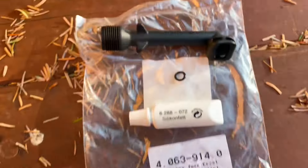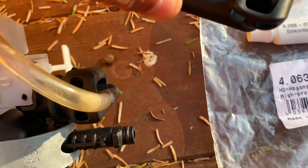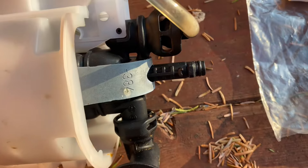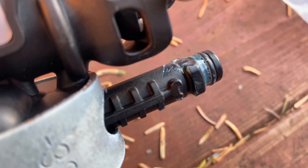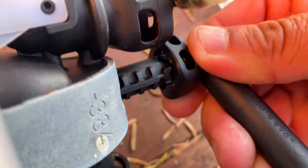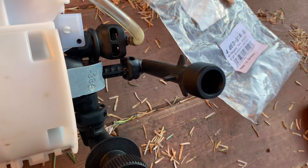So I'm just going to get this fitted. In there on the main unit there's the o-ring — you can see it in there, so I take it that's the one I want to see replaced. I can't see there being one in here anywhere. So I'll get this one off and replace it with the new one. That's the new o-ring on there. A bit of silicone. Fit this bit back on — just push that in there and turn it. That's it fitted. We'll go and connect up the power and the hose and see if this has worked before I put the whole thing back together.